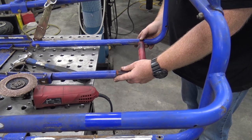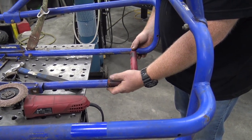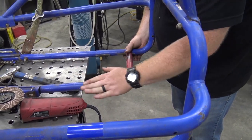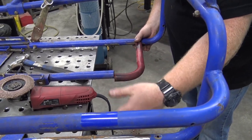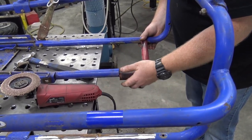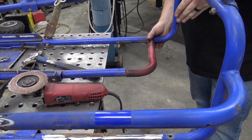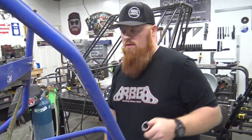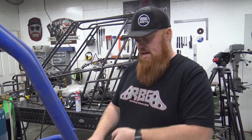So basically I can weld it around this, weld it to this, and that'll give us a brace, and we can put our engine plate right here, kind of centered on this tube. It'll overhang like that. Our sprocket will go right there. Our brake will go somewhere right in here. We'll just try to keep it a little tight. And then we can do a brace slanted from this, because we've noticed the wheel tweak on Eli's go-kart when it got done. It kept kicking the chain because this whole back section was twisting. So we're going to add that brace right there.